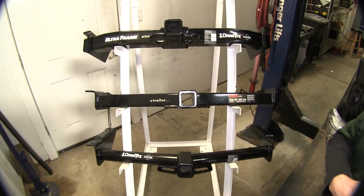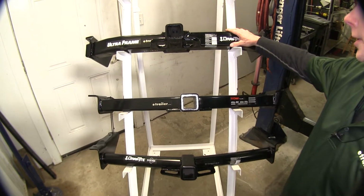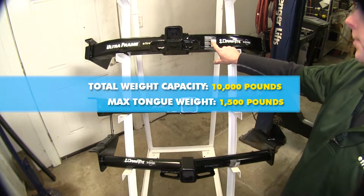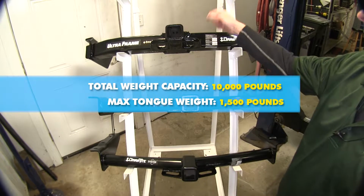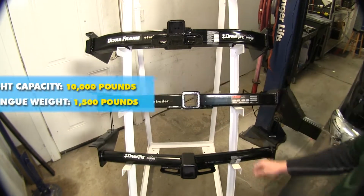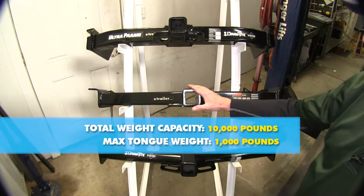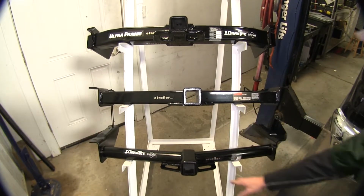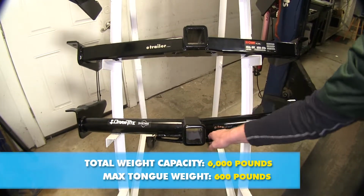All right, let's go ahead and cover the weight capacities of our hitch. First off, we'll start off with our heaviest one right here, the Draw-Tite Ultra Frame, which is rated for 10,000 pounds of pull weight and 1,500 pounds of tongue weight, which is the weight that pushes down on the hitch. Next up is our Curt. By itself, it's going to have a 1,000-pound tongue weight capacity and a 10,000-pound pulling capacity. To go down to our Draw-Tite here in the 75 series, 600 pounds of tongue weight and 6,000 pounds